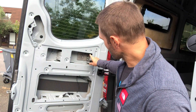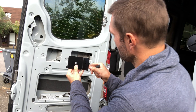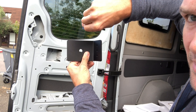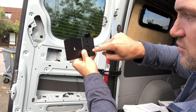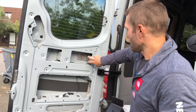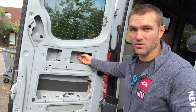We designed this part that kind of looks like an upside-down hockey stick. There's really little clearance in there to get your hands — you can't really get behind and hold a nut on. So the way this works: this plate sets in there with a piece of door sheet metal on the back side, then you come in from the top, lever it behind, hold it against the plate, put the screws through, and find those nuts that are welded on the back. Tighten that down — as you tighten one, the other will loosen a little, so tighten them both down tight. Then put the sway link through and tighten that nylock super tight because you don't want that to move on the door.